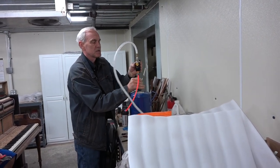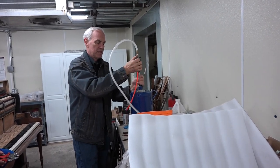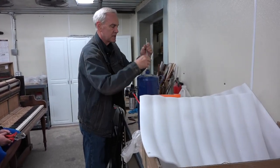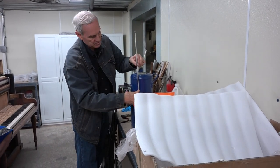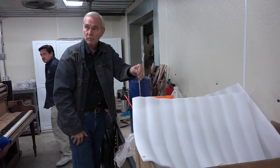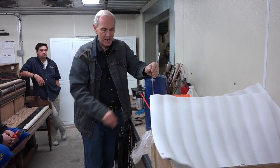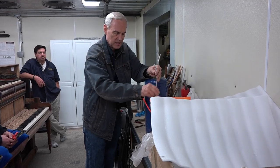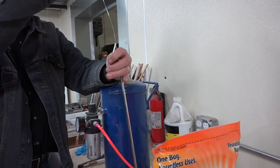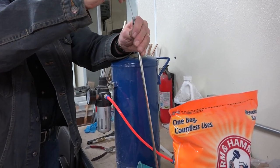You have to unscrew this feeder tube and you can't lift it up too much because of all the hoses. But once that's up you can tell — right there's where the soda is — so we're half full already, we don't need to put a bunch in there. How can you tell if that straw is clogged? Well, as long as it's coming out, that means it's flowing. But that's what this wire's for — to ream that out. If you push this down you will hit a block and you will know it's not going.